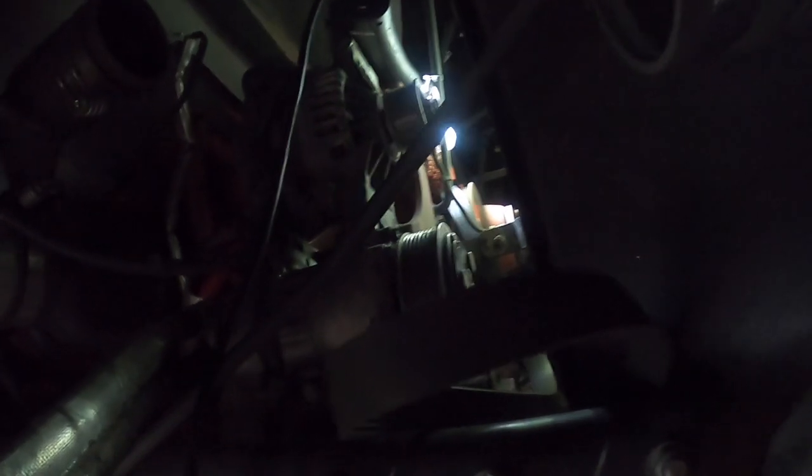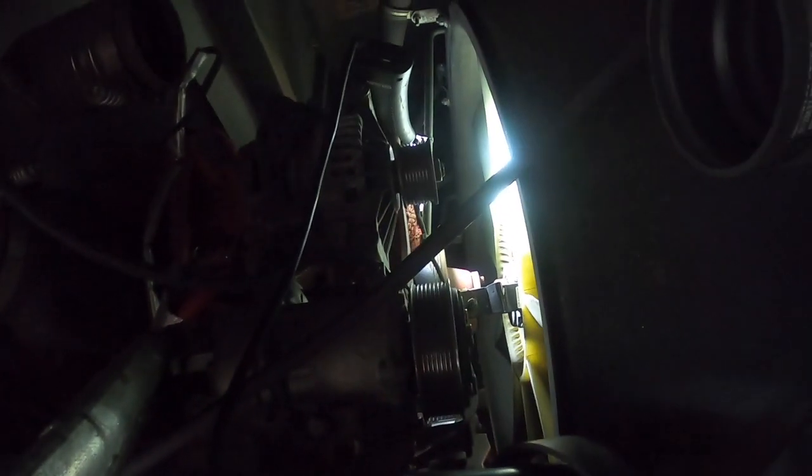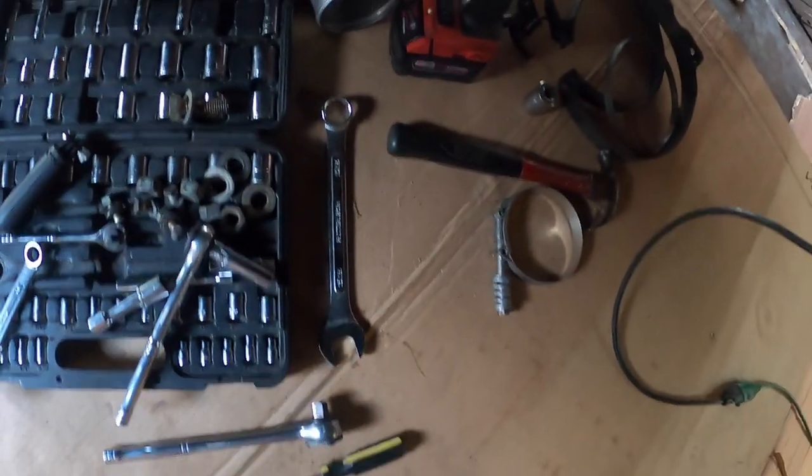I am on the flywheel right here - the belt goes way up in there. I have released it from the flywheel. The belt is all loose except around that fan, and I still don't know how I'll get it out from around it. I'll have to fish it around between the radiator shroud and the fan.